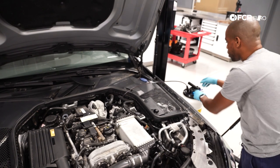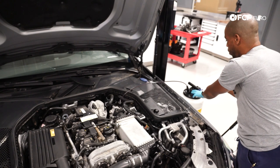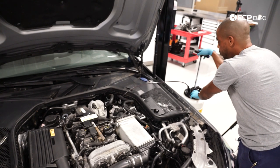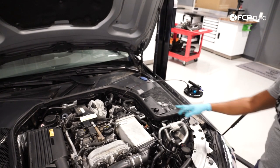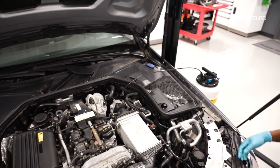To begin extracting, start pumping. If you hear air coming out, the valve is not in the correct position — just go ahead and close it and then begin pumping. Give it about five pumps to start, and as you can see the oil is going through the extraction hose and you can step away.